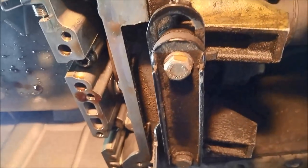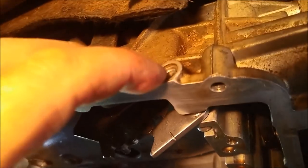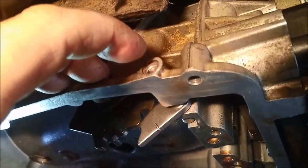You can see the oil was shooting right through and out here. So we'll put this little boot back on — there's another little boot thing that goes on here. That's provided my o-ring hasn't been cut, and it doesn't look like it has because you'd see a little strip of rubber if it had.